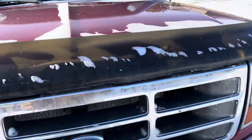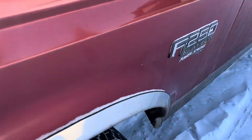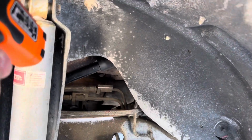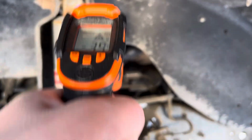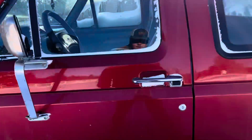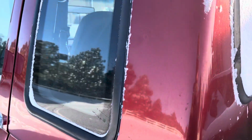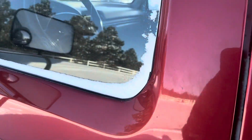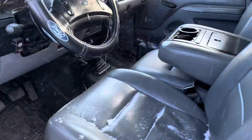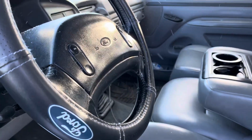And it has not been plugged in at all. Let's see. Try to hit right there. Yeah. So it hasn't been plugged in at all. It has a White Rogers glow plug relay, also known as the Stancor. And when I did all 8 injectors, I also did all 8 glow plugs 20,000 miles ago. I did all Motorcraft. So that's right, White Rogers relay and the 8 Motorcraft glow plugs.